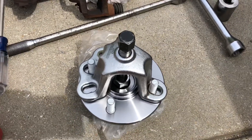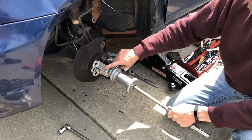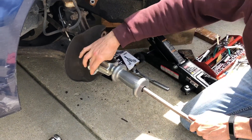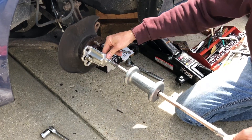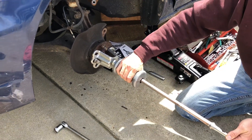Obviously here's the new hub, and next we'll go ahead and try to pull that old hub out of there. I've got the puller mounted here to the hub. As you can see, this is pretty tight. I tried to tighten these up as much as I could — 19 millimeter socket. Then I put the slide hammer in here and tightened this bolt here to keep everything tight. I'm going to go ahead and give it a try here with the slide hammer.